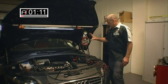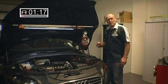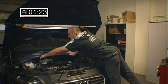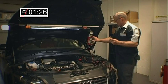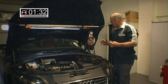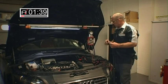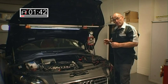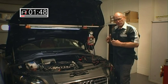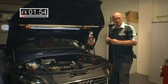First of all, this particular tool has, effectively, three main features. The most obvious one is that it creates smoke. For the purpose of this, if I remove the nozzle momentarily, I'm just going to give the heater circuit a short while. Within this chamber is a very light oil. We've added a UV dye to it, which with a UV lamp helps identify very discreet leaks across gasket faces and flanges, which normally would be very difficult to determine.